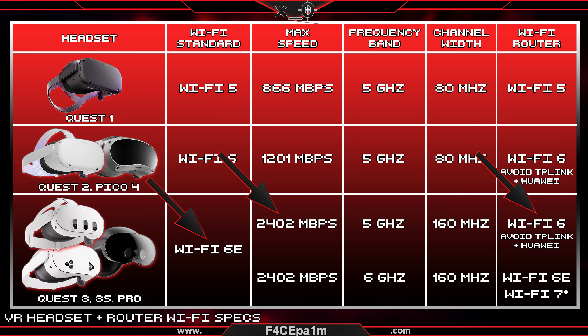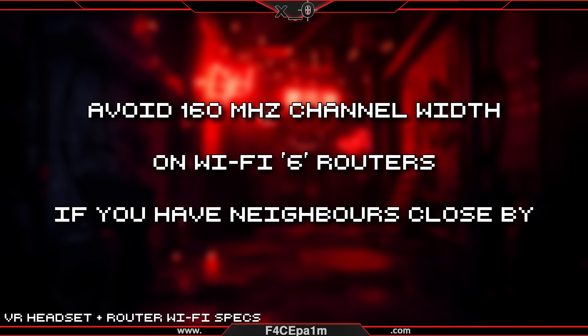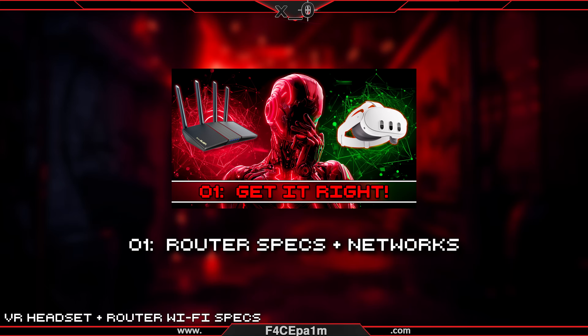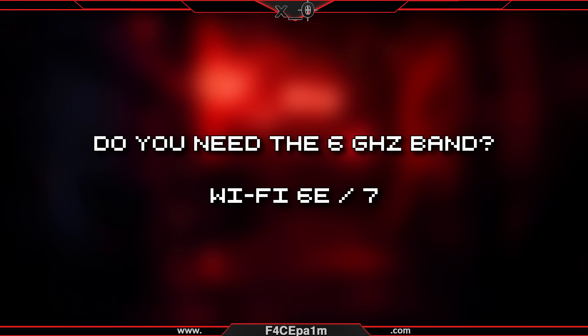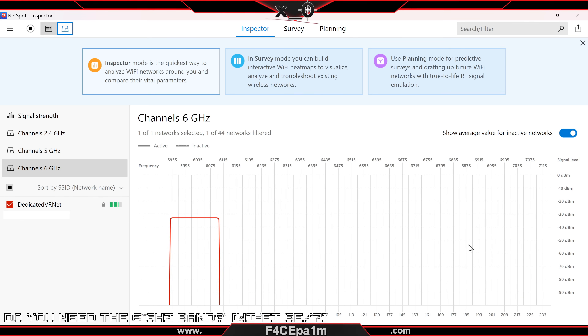You can get that 2400 Mbps speed on a Wi-Fi 6 router if it supports 160 MHz wide channels, like the ASUS AX58U, aka AX3000 router. However, I strongly advise against using a 160 MHz wide channel on a Wi-Fi 6 router if you live in an apartment or have neighbours close by, as that channel width will pick up way more interference. In this case, stick to a narrower 80 MHz wide channel on the 5 GHz band and run with a 1200 Mbps connection speed. The 6 GHz frequency band on Wi-Fi 6E and some Wi-Fi 7 routers is of real benefit, as this separate band can be clear of interference from neighbours' devices, which means a smoother VR gaming experience.